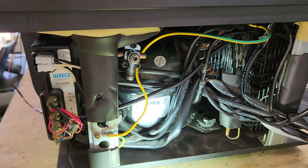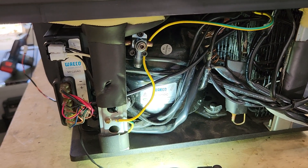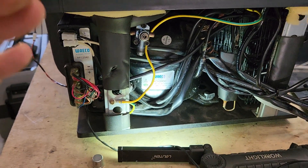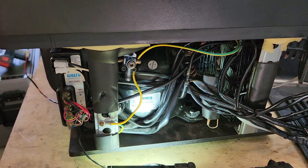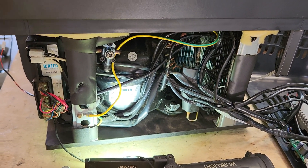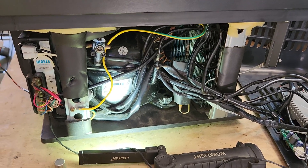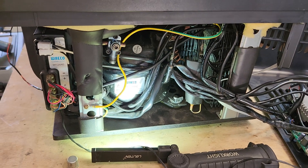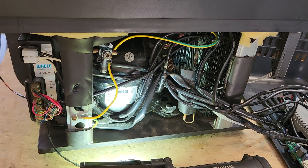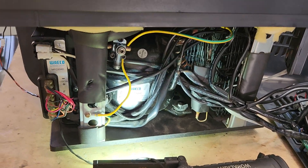The liquid is injected into the internals of the fridge, and as it changes state from a liquid to a gas it gets very cold. The evaporator plate on the inside of the fridge is quite cold - the ambient temperature in the fridge might be at 3 degrees but the plate might be at minus 12 or something. It's a heat transfer process, so think of heat not as in a stove or hot weather, but as a relative thing.